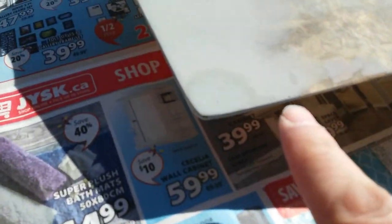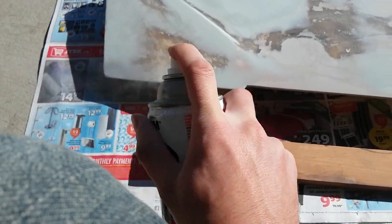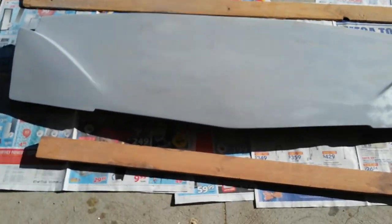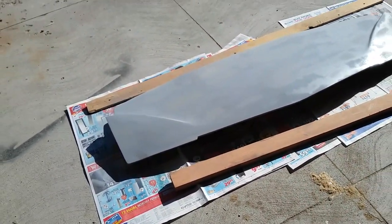There's a tiny imperfection — we'll see if the filler primer fills it. Start on one end and go all the way across in a nice slow, very light first coat. Let it dry a few minutes, then go the opposite direction, then diagonal — that ensures absolutely zero patterns in your finish. After three coats, it filled in almost all the imperfections. The only thing it couldn't fill was some tiny little air holes that came from the filler.